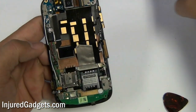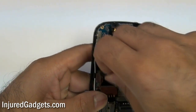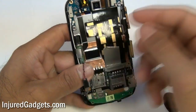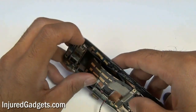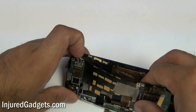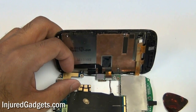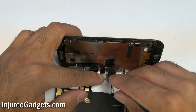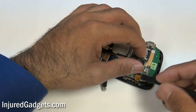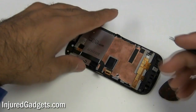Once those two screws are removed, go ahead and remove the vibrator as shown. Remove it safely — don't rip that cable, just remove that top portion. Unplug your digitizer cable as shown, and once that is removed, you can go ahead and separate the actual motherboard from the back housing. Don't pull it off just yet because there is a cable underneath the motherboard still connected to the phone. You want to go ahead and pop open this jawbone connector — it pops to the right — and then the LCD cable comes loose. Additionally, disconnect this other cable shown, which makes the keys on your bottom touchpad light up as well as helps them to respond.